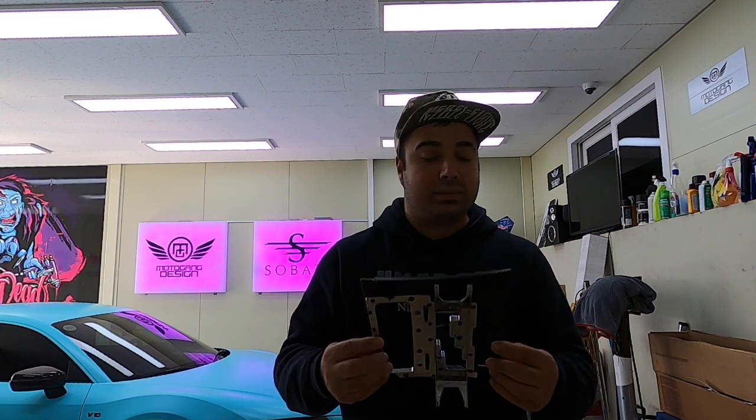Before I start, one thing is very important: when you're using a film like carbon or shadow black, or a film that has a pattern or design on it, you should really follow the shape of that. For example, with this carbon, if you start from the left pattern, you have to do the same on this piece and then the other piece, so all should be the same. That's very important. I saw other people wrap it, or those who do DIY, they don't know. That's why their lines are not matched, one on the left side and one on the right side. So that's very important to make your job look clean and nice. Let's do it together.